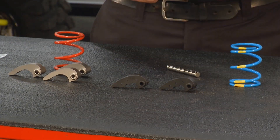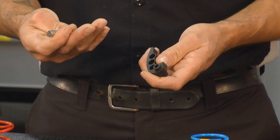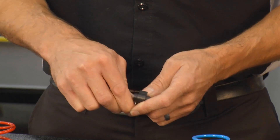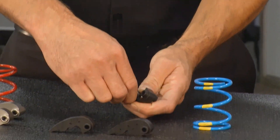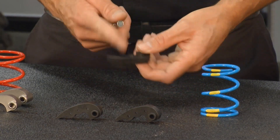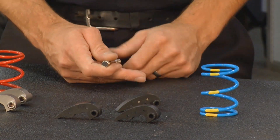This is our adjustable clutch weight — this machine is going to take three weights in the first two holes. These are magnetic weights; you just slide them in here and they snap right into place. These are earth magnets — they don't come out. You put these weights in with the springs and you're all set. Based on the machine and the setup, we determine what they're going to need as far as weights go.